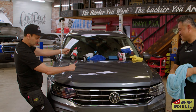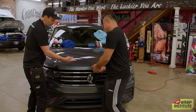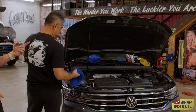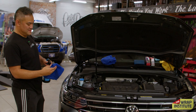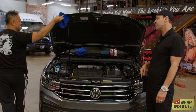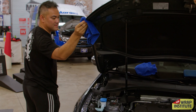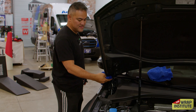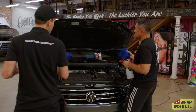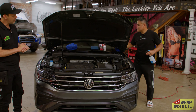Now you've cleaned the hood, but you haven't cleaned the edges. Open the hood and prop it. Come back to the cleaner and clean the edges — do what's called the 360: start at the middle and do a full loop to make sure all edges are clean. One consistent wipe around. Check the towel as you go — if it's dirty, do it one more time. The material fails most on the edges, so edges must be perfectly clean. The 360 is fast and super efficient.